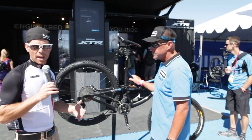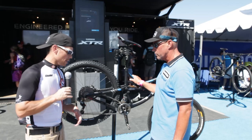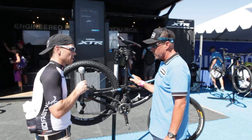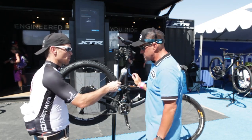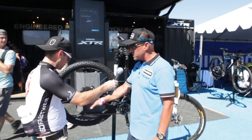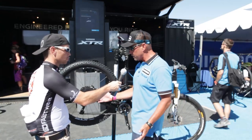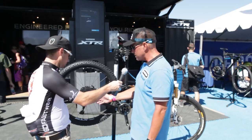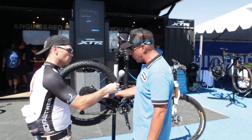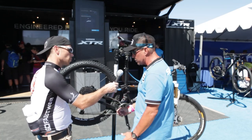One of the fears we all have is: we get out there riding, having a great time, but we end up crashing — which we all do on mountain bikes. How vulnerable is this derailleur? We've all torn derailleurs off, and that could totally happen here. Just like in a standard derailleur system, this does have a breakaway magnet. So if you fall over on the side, it breaks away without tearing the servo motor apart. You have some safety with fall-overs. If you catch it and rip it off, the hanger is going to go first — and if the hanger tears off, the derailleur with the magnet breakaway will most likely hold together just fine.